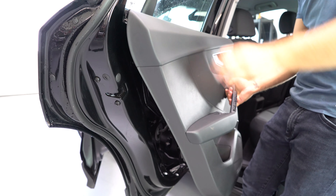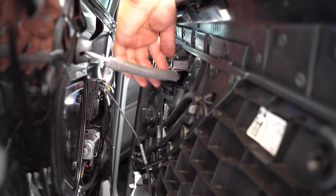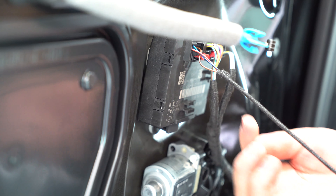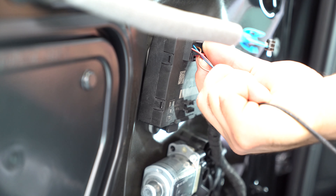You need to know that almost all Audis have this system. You just need to pull this cable away from the door panel like that. For the window switch you'll have this red tab that you need to pull like that. After that, beneath you'll have a tab that you need to push and pull.